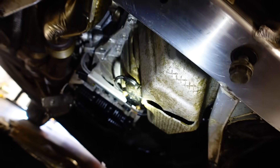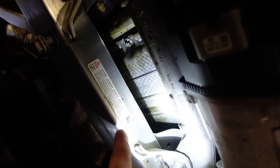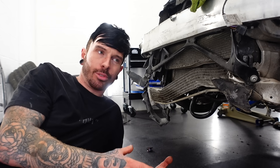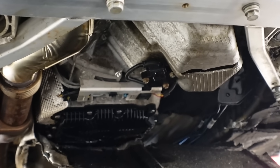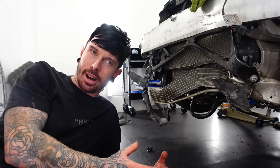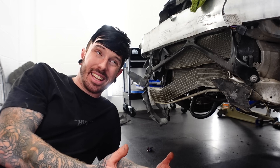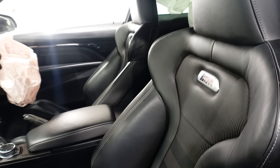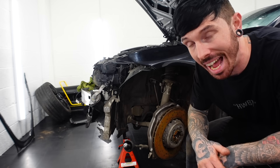So potentially the bottom end could have gone if the engine has been run with no oil in it. To get the sump off, all the subframe has got to come down anyway to check for the damage. Fantastic - this is all just great fun, isn't it? The conclusion: the gearbox sump has got a hole in it, the engine sump's got a hole in it. There's no point buying new sumps and trying to run it yet until we strip everything down and see the extent of the damage. I've got to drop the subframe, take the sump off, and then hopefully check if everything's okay. Definitely something I didn't take into consideration, but when you buy these cars you expect the worst.